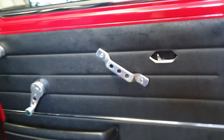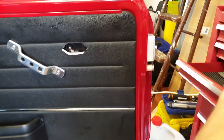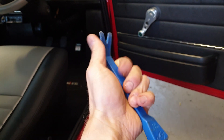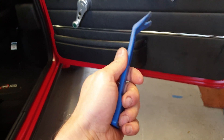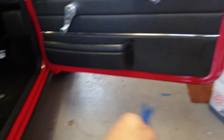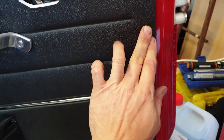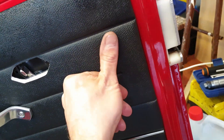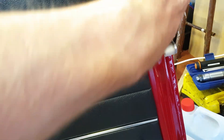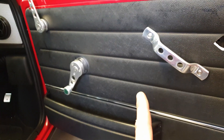That's the driver's side door done. If you are going to do this, I'd suggest buying a complete set of new clips — you are almost guaranteed to break them. I've got a pry tool, very cheap off eBay, which makes life a lot easier when removing these because you can get underneath and properly pull them out rather than using a screwdriver — and being plastic it won't damage the paintwork. I've struggled on this side because I've got central locking, so there's a screw that meant I had to take a bit out of the back of the door card. It does sit ever so slightly proud and doesn't quite go in, but I'll order more clips and redo that. Apart from that it's gone on really well — really impressed with the quality. Newton Commercial, worth a look at.